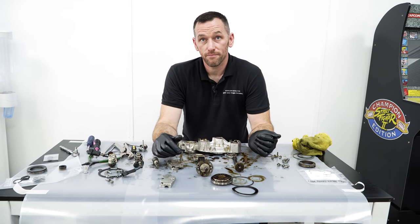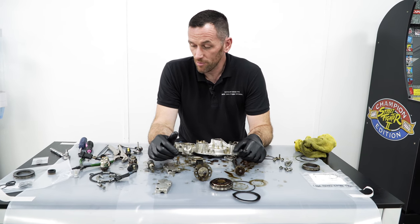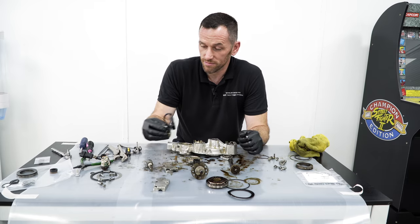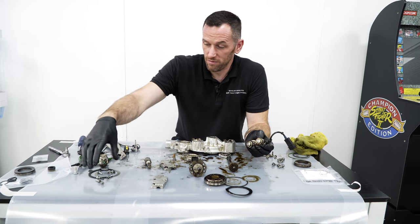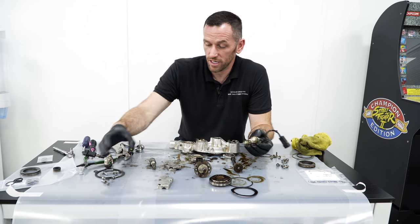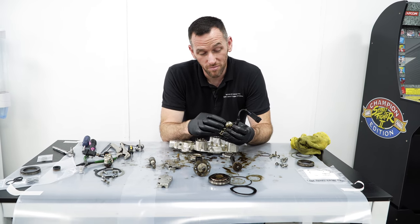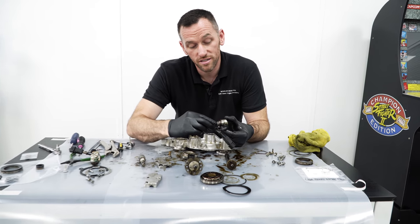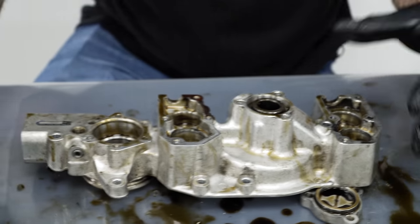So you basically said you haven't seen any real obvious issues in this unit itself. Not particularly, no, there's nothing. Obviously, there was that snapped plastic ring, but you said that's pretty common. Common, so that'll get changed. We'll fit it with the new metal ring that we use and a circlip. All the bolts will be replaced. We'll clean the solenoids and test them. There's some minor wear to that solenoid edge there, where it's been twisting in the unit, but I don't think it's caused any marks.